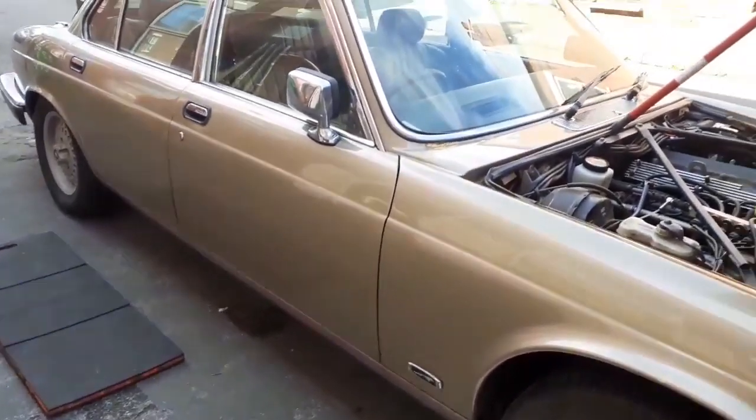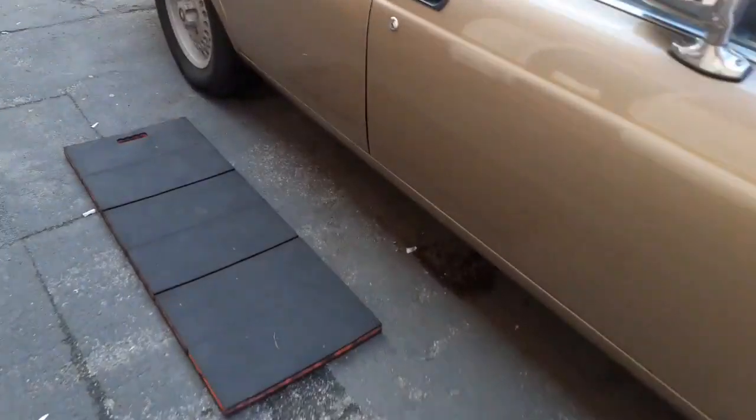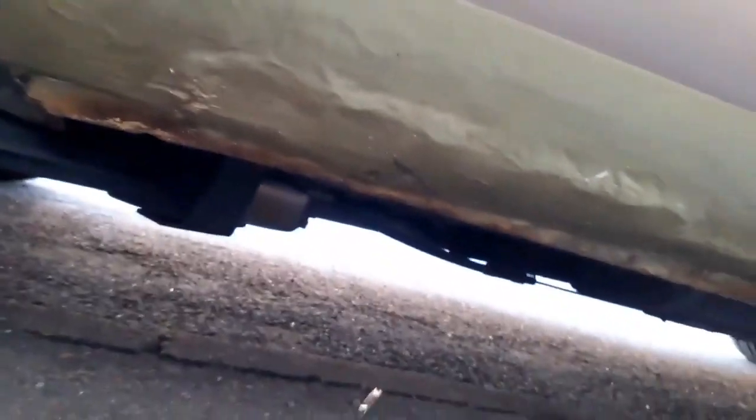Welcome back to BL's Above the Jack. I'm going to have a good look at the sills. The sills are a bit of a nuisance, actually. There is rot in the very bottom of the sills, and there was rot in the sills before I bought the car. And I've looked, and somebody's blocked up — I don't know what they've blocked them with — the drain holes.